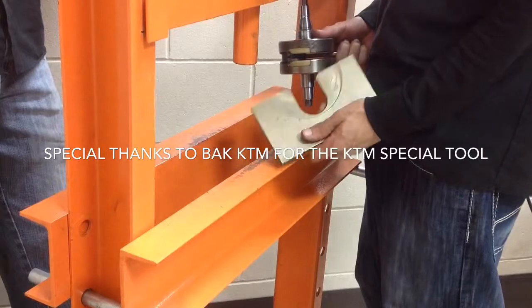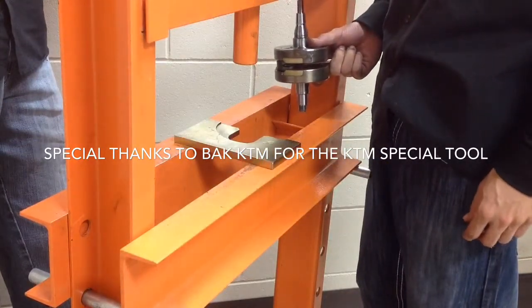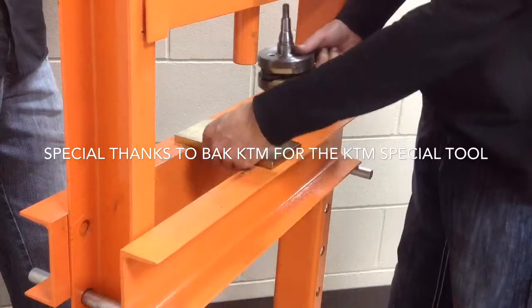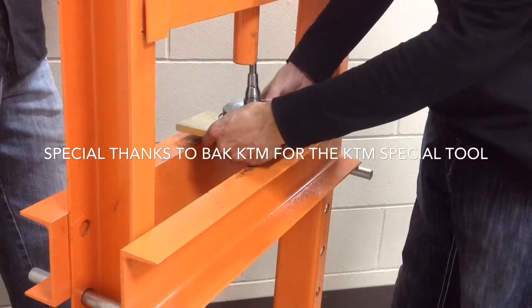The rod is totally gone on it. With this press plate you only have to press one half web at a time instead of pressing the pin out of both webs at the same time. Notice how he slides it onto the tool — it cradles the rod so that the rod pin ends up in that U shape.